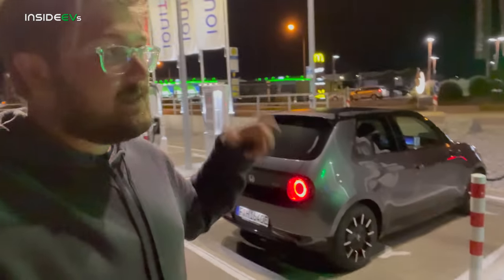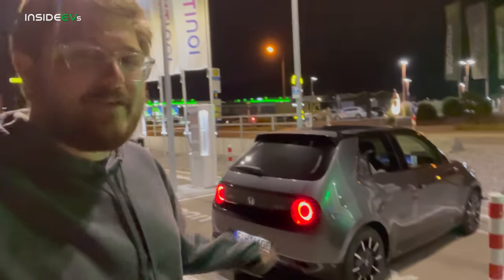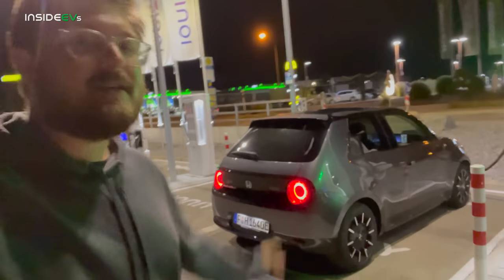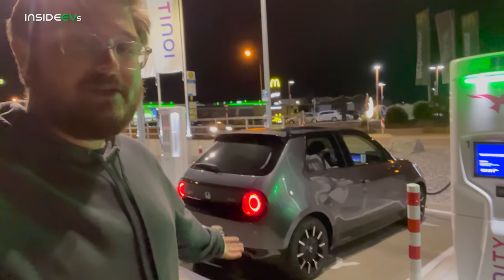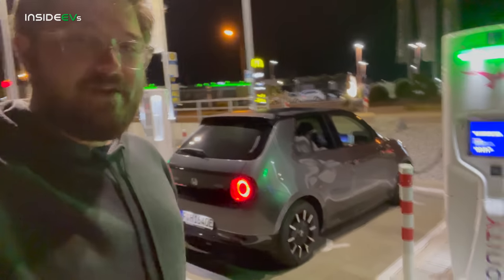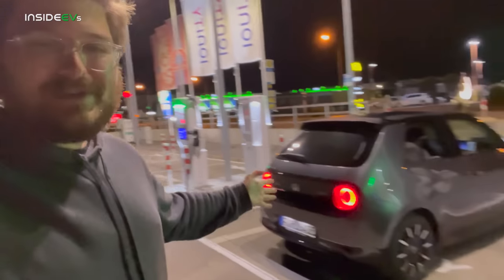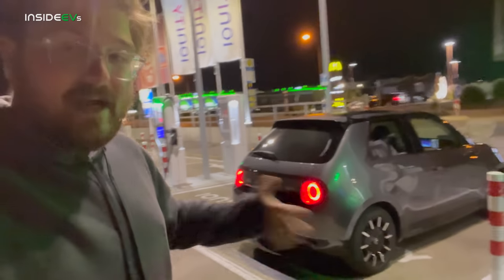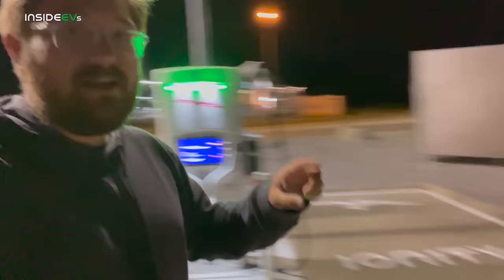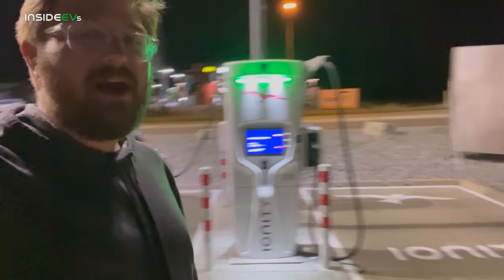When we unplug, it's a little bit chilly — about 15 to 17 degrees Celsius out here. The car isn't going to have to warm up and we won't have mixed results. This also helps level out the results between winter and summer range tests. If we can start at a nominal temperature for that vehicle, we're good to go. The Honda E tire pressures I just set at the manufacturer cold tire pressure ratings. We're going to get on the highway, which is literally 150 meters behind me, and set the cruise control at 70 mile per hour constant.